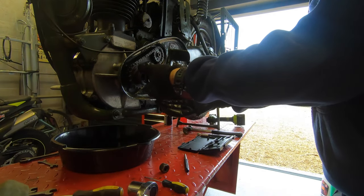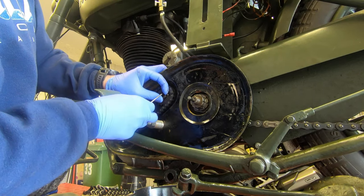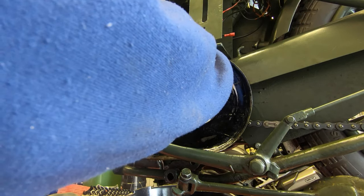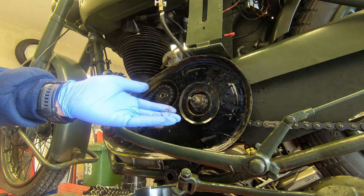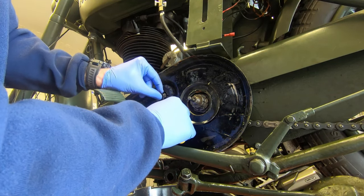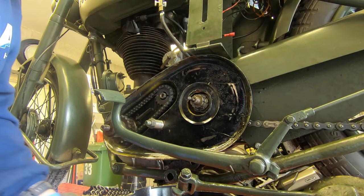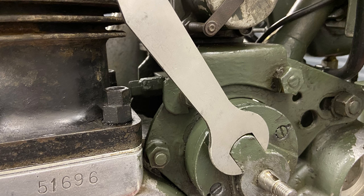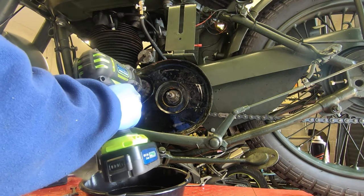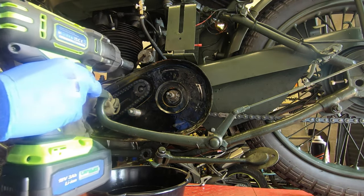That springy thing behind it is a shock absorber which helps to smooth out the bumps from the engine. Now for the dynamo sprocket there's a little spring clip which needs to be removed and then a washer with a tab on it. The dynamo nut holding the sprocket on will turn when you try and undo it. There's a special tool you can use to hold it from the back because the space is too thin for a spanner, but if you're a tight wad you can get around this by just stuffing an old t-shirt into the front of the sprocket to stop the chain turning, and then it'll come off easily.